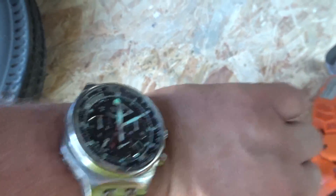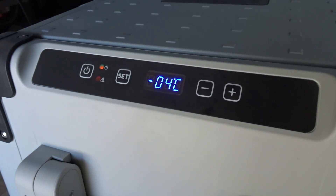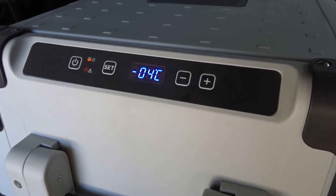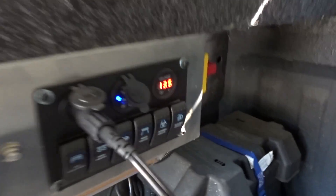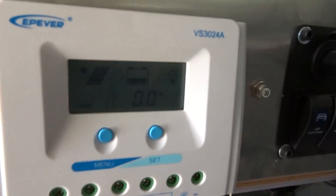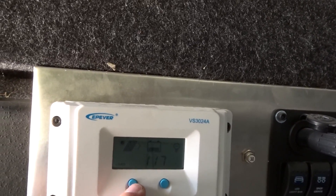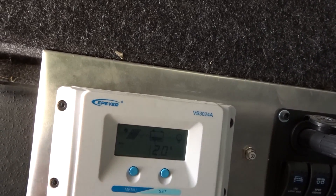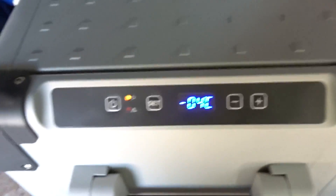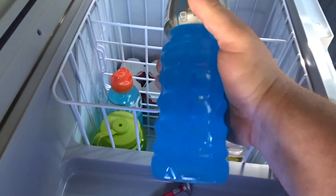Update on the cooler — it is 10 after 12. It's been plugged in since 8:30. It's in standby mode right now because once it warms up enough the compressor will kick in and cool it. Still looking at 13.5 volts, so we are charged up. Coming in: 13 volts and two amps. I'll grab myself a nice Gatorade — oh yeah, nice and cold.